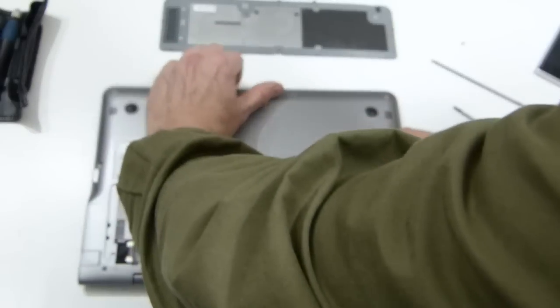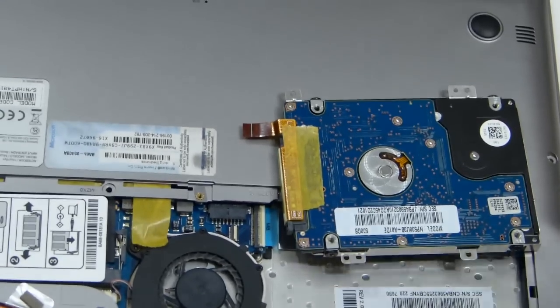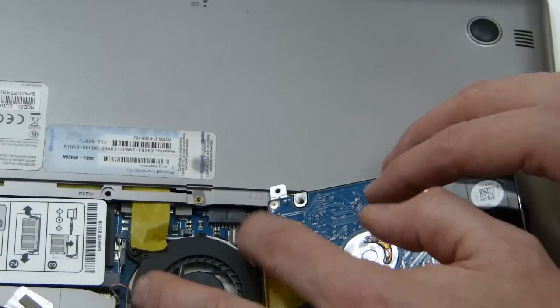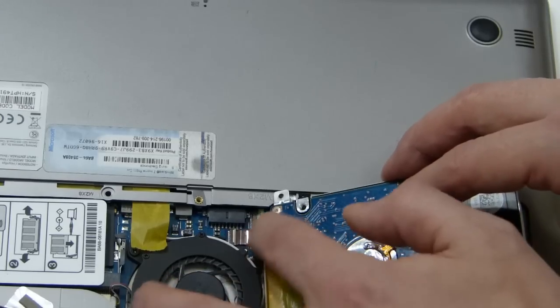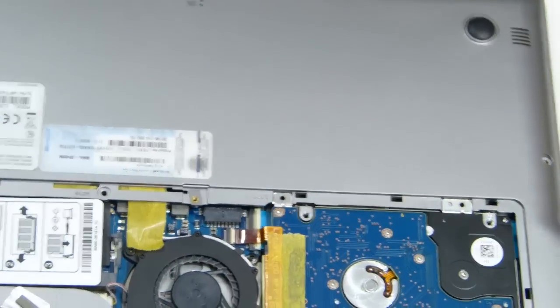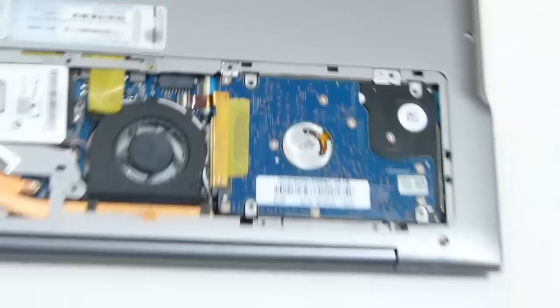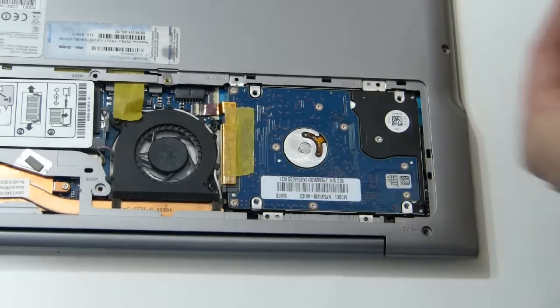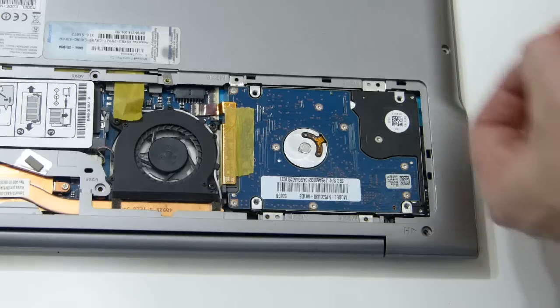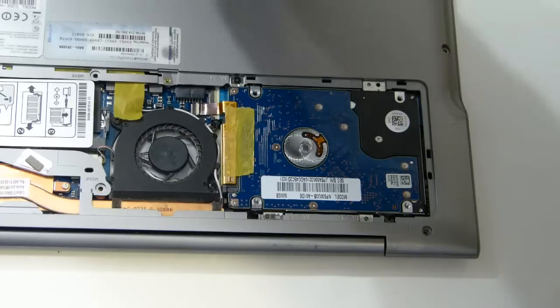Getting the hard drive back in is a little tricky — make sure that cable is in there. Let me zoom in because this is an important bit. You can see a white line on the connector. You need to put it into the connector all the way up to that line. Make sure the little flip-up latch is raised, then insert it — it goes nearly but not quite all the way. Once connected and latched down there's a little bit of space there. Then put a couple of the screws in — they're all 6mm screws in this part of the device, not the smaller screws used for the rest.